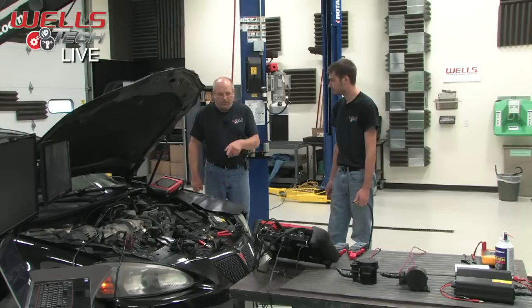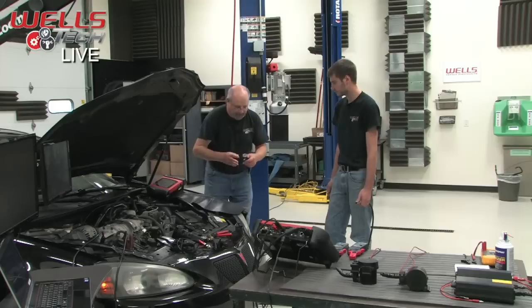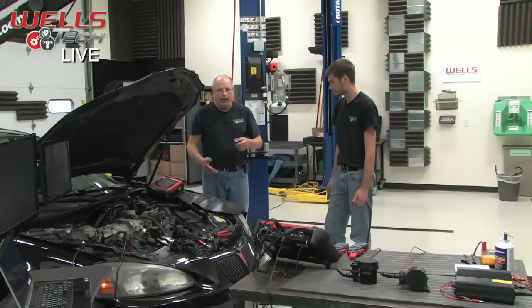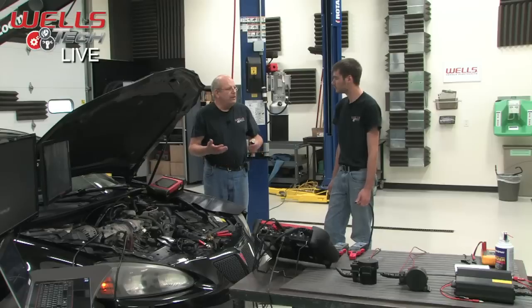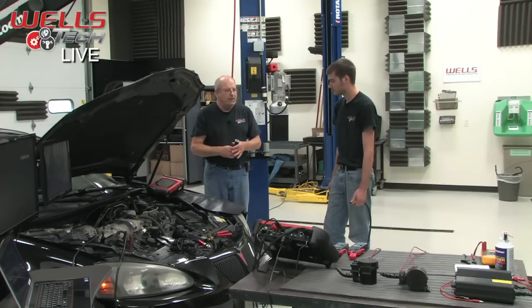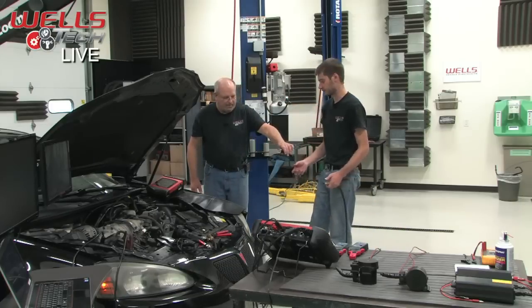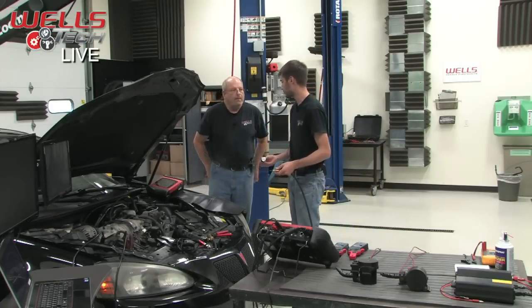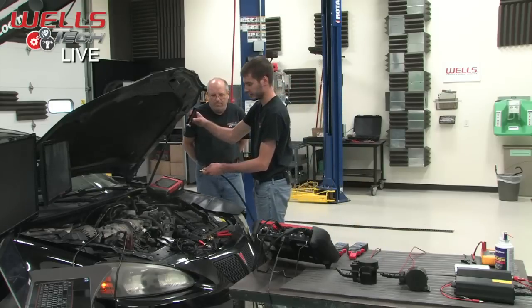And that's a good time to bring this up. Yeah, where exactly. You should have a laser light or a black light. You have dye in the smoke, so then you can put on your yellow glasses and you can see where it actually has residue on it. Right, and sometimes when you get small leak codes and such, it's very hard to find where the smoke's actually coming from or actually being able to see it, where a laser light can actually help with that.